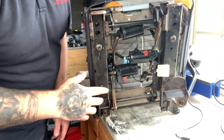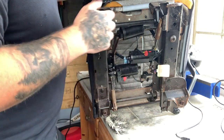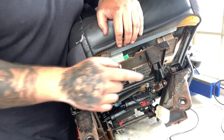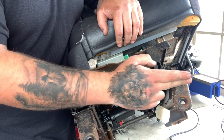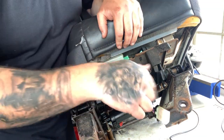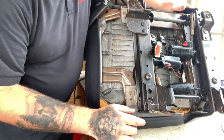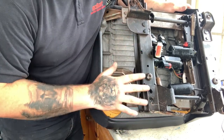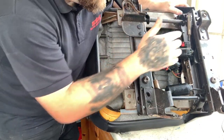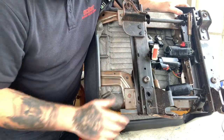You can see all the gubbins under the seat now - the electric motors for the seat, three of them. What I'm hoping to do: these are the front mounts, cut this one the same amount as we're cutting off the rears. This one's at an angle so I might just cut an amount off and tack it in place on the car, then pull the seat back off to fully weld it. It's worth mentioning that you don't have to worry too much about getting them perfectly level because these seats are actually height adjustable front and rear separately, so we'll be able to level it out then.